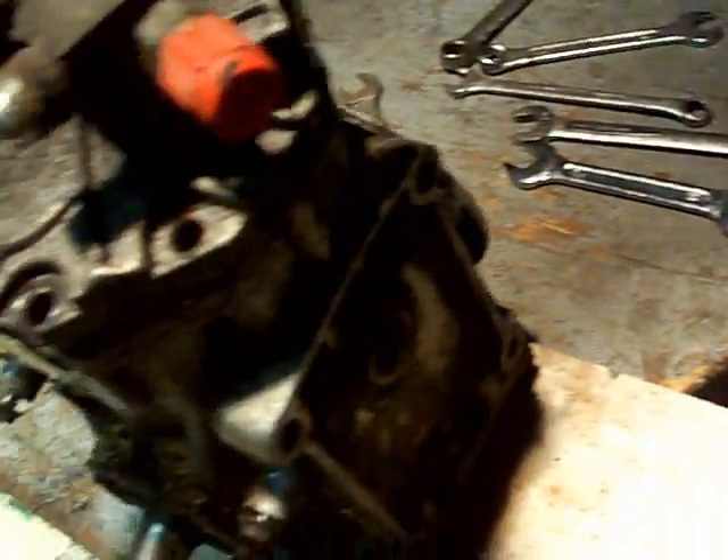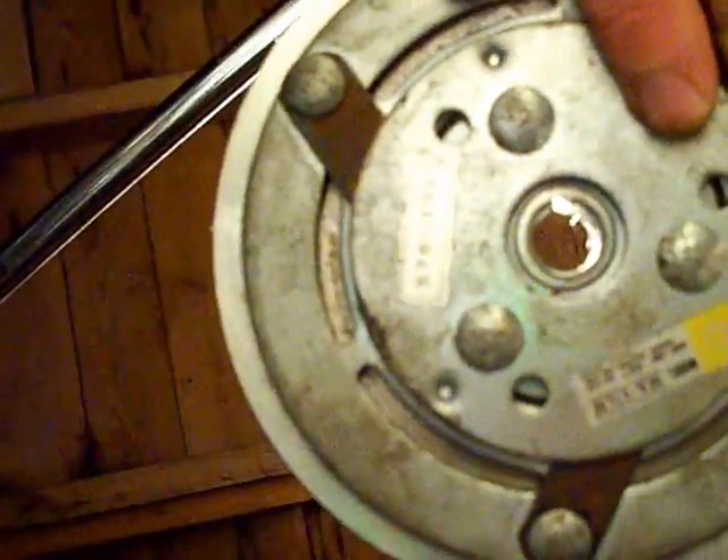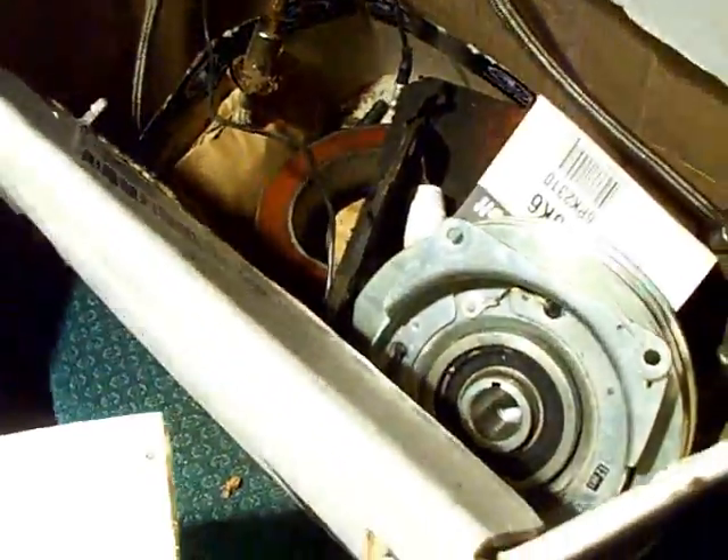These compressors came in various vehicles from the '70s and '80s — Fords as a dealer AC option, some factory options, Volvos, Ferraris, AMCs. GM didn't use them because they had their own. Some Chrysler and Ford products used a Ford-branded compressor that's virtually the same and uses the same clutches. This clutch I actually got from AutoZone for an '87 Jeep Grand Wagoneer, which is probably one of the vehicles you'd be able to junkyard-pick one of these compressors from.